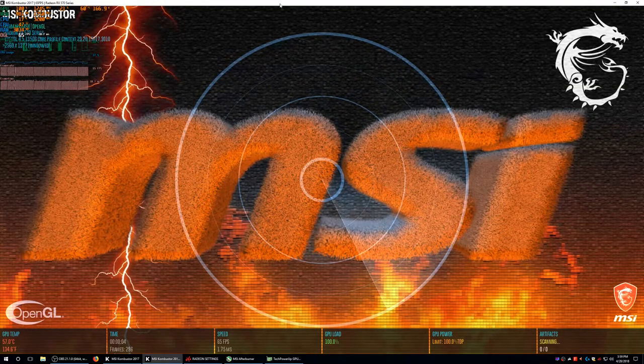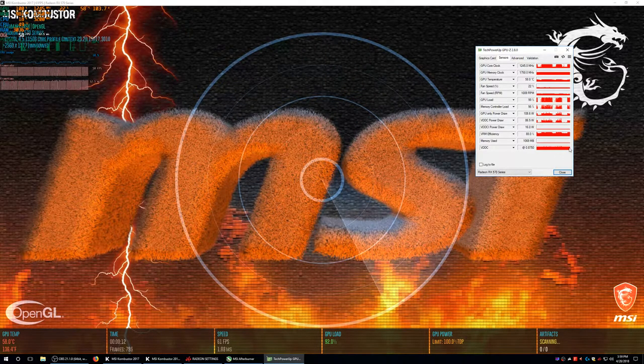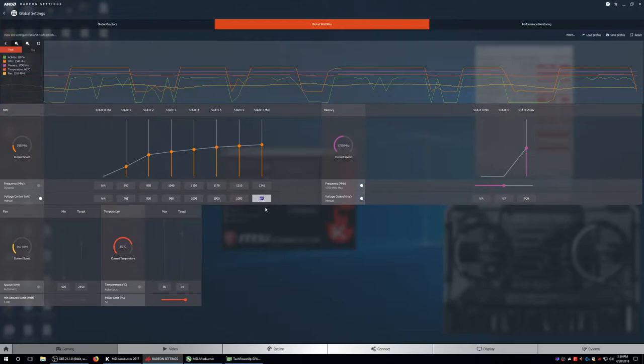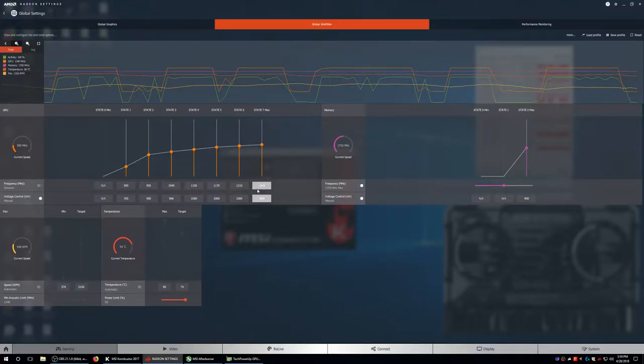I'm expecting some artifacts with this one because GPU-Z reads about 25 lower than what I actually put in, which was 880 mV, giving about 860 mV actual. The 881 mV was kind of my lowest before. Not getting any artifacts right away, which is interesting. I don't feel safe at 860 mV so I'm going to put it on 870 mV.